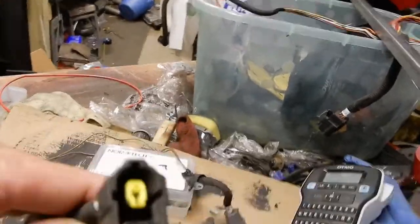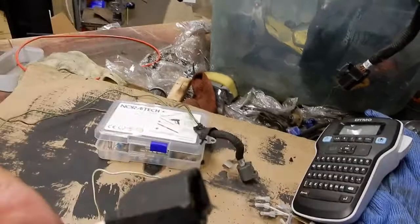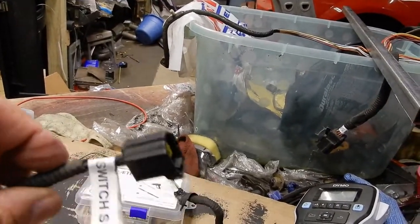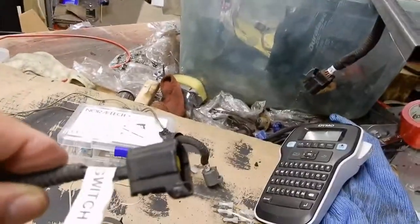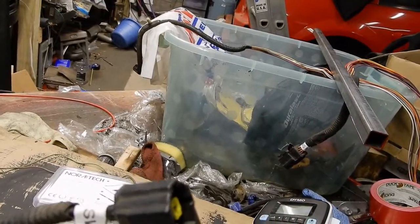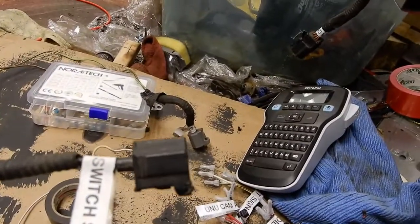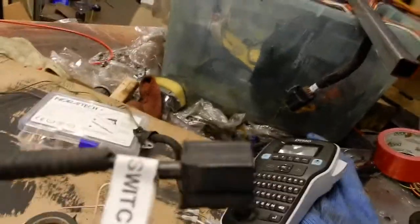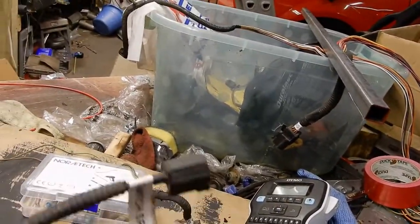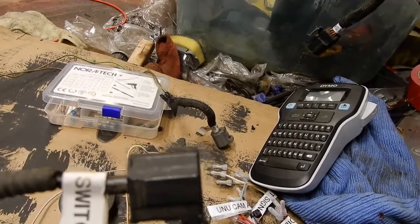Here's your oil pressure wire. How can you get oil pressure with one wire? It's a six-pound switch — whenever the engine produces more than six pounds of pressure, your gauge swings to roughly the middle so you feel happy, but you have no idea how much actual oil pressure you have. For that I've got an aftermarket gauge that was already in this car — one of the few good things the previous owner did. I'll take the stock switch out and add an input so the Barra PCM can hook right up to it, and I'll also plumb in the other sensor so the Barra PCM gets a ground at six pounds, just like the V6 PCM did.